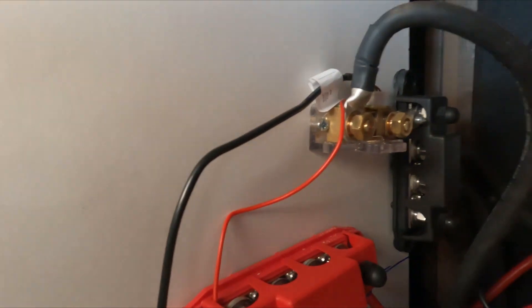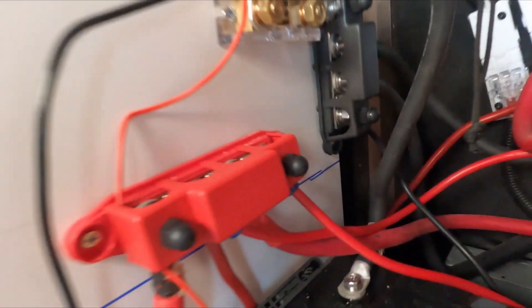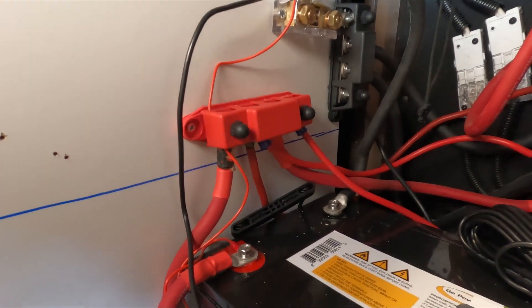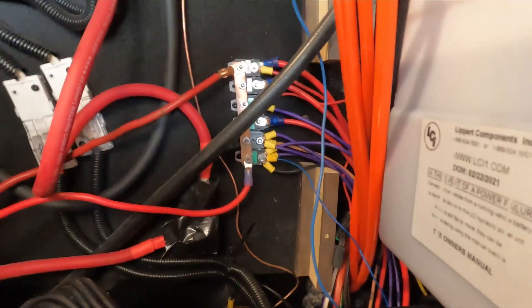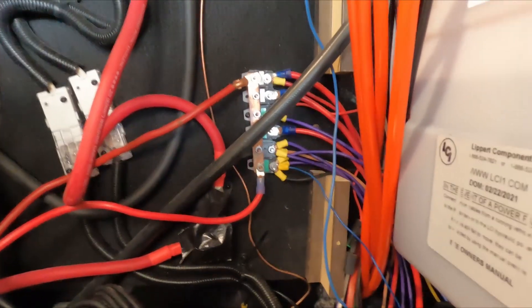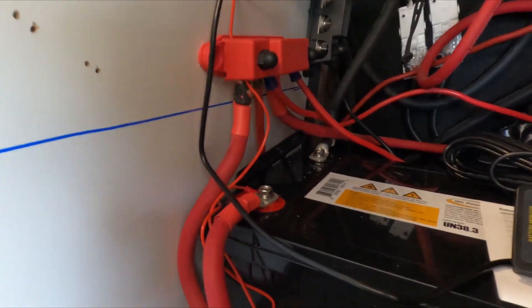I now have a dedicated place for the 12-volt and a dedicated place for the ground to go into the bus bar. Everything has to go through the shunt first and everything is singled out. My two bottom connectors are for the solar panel — that's where it comes in and feeds into the system. One connection for my inverter, and then the connections that go to the main coach all go through that one bus bar. I want to change that at some point as there's too much for one bus bar with those little connectors.